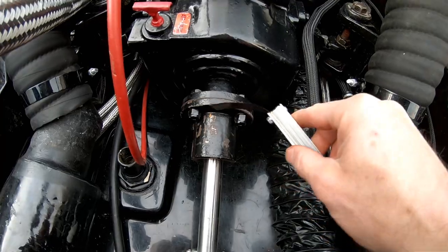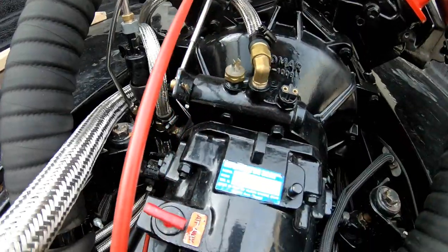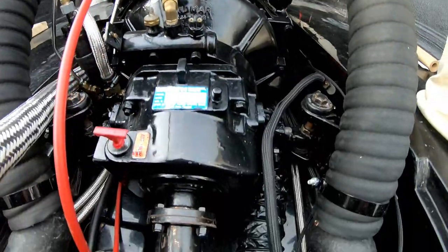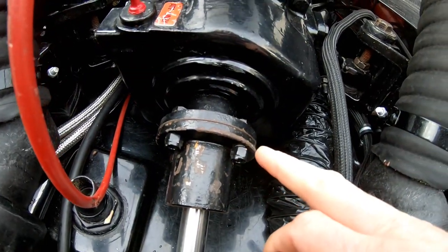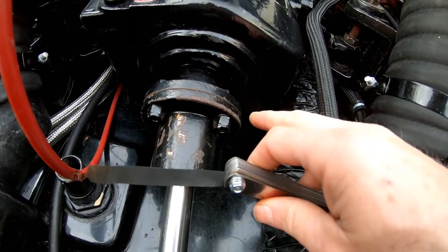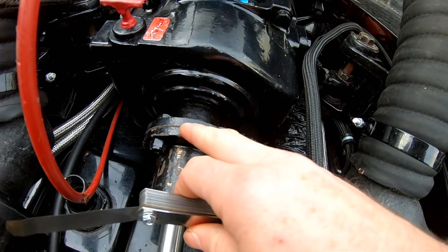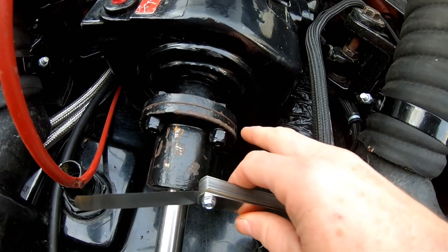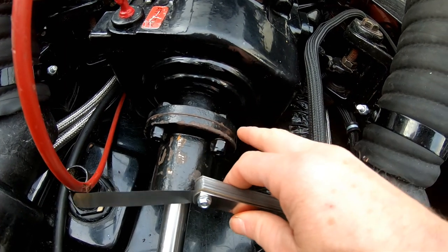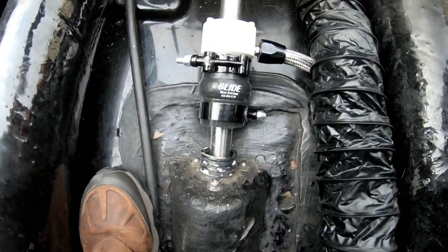All right, I think we got the engine realignment done. So I made adjustments to these engine mounts up and down, and then going left and right at the front. I got the coupler, so 4/1000th of an inch doesn't go through top, bottom, left or right. I got it to 3/1000th of an inch that barely goes in top, bottom, left and right and feels the same on every side. And the 2/1000th nicely slides in and feels about the same top, bottom, left, right. So I think we can call that good on the alignment, and we'll just tighten it all back up.